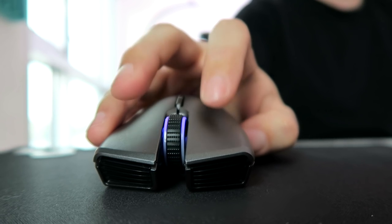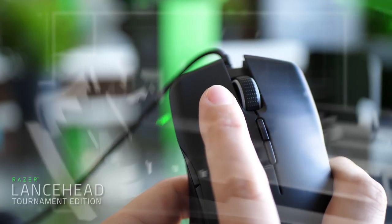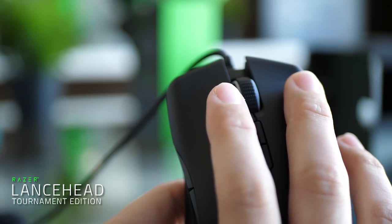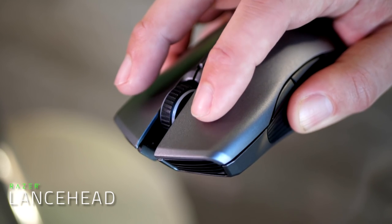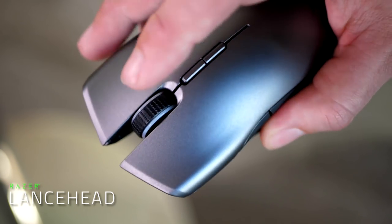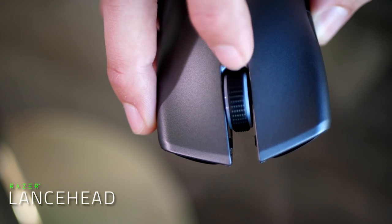Moving on — let's talk about the buttons and switches, and they're all pretty awesome. With the Razer Lancehead, Razer co-developed their own mechanical switches with Omron, featuring a new alloy with very high durability up to 50 million clicks. I really like that they re-engineered the contact points — left and right click on the Razer Lancehead Tournament Edition are really crisp and definitive. They actuate so fast and so light, it's so much fun to use. However, the Lancehead Wireless is noticeably heavier for mouse one click. The plastic top shell on the Wireless is subtly smoother in texture, and a different top shell could be what's making left click noticeably heavier to actuate since the plastic has to bend for clicks.